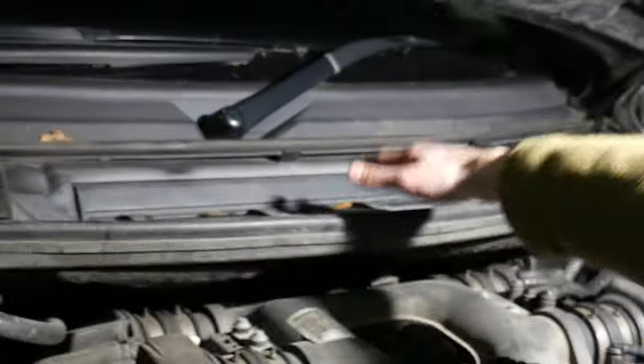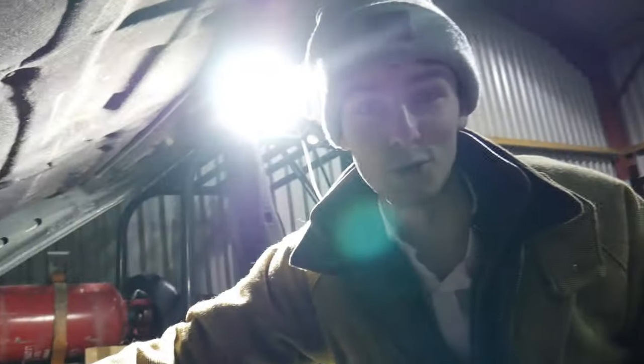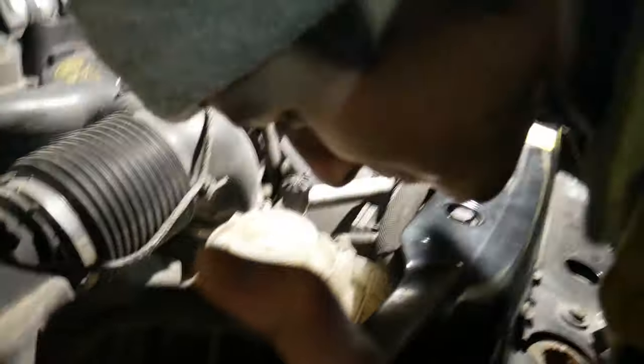The cabin filter for the engine is behind here, so all of that will be coming off and then I will be inspecting the oil cooler, which is behind the back of the engine. A known issue on these cars is the oil cooler leaks oil into the coolant. Does it smell of oil? Probably. I mean, there is coolant somewhere down there.